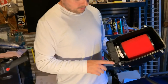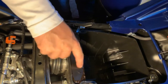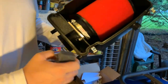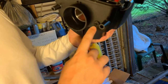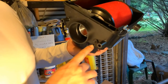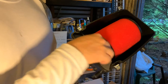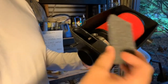At EHS Racing, they remove this plate, get the old cheap brown glue off, pop it off, and leave it open. They send you two foam blocks — a foam air filter media that wedges down in there. This side is where the AIS goes in, and you'll also have to transfer over your air temperature or air pressure sensor into that port. On the other side of the chamber is where the crankcase breather comes in, and again you have a foam block.